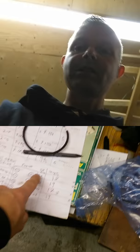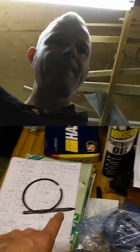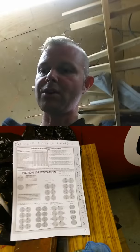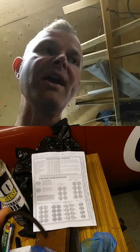When I gapped these rings they came in at approximately 19-20 thousandths of an inch, but using Keith Black's equation for what they should be for a standard car, they're at least five or six thou too small. That's critical — if the ring expands and the gap is too small, it will bind in the cylinder and you get big problems.